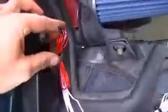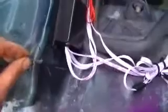You've got these wires coming from this connector box right here. First, there's one red wire. It's completely red. This one does absolutely nothing. There's also a black wire, which you're probably gonna think, hey, it's a ground wire. This does absolutely nothing. You can use it as a ground, but you don't need it. So I just put a little bit of electrical tape on the side that was showing, and on this one, I just wrapped them up.